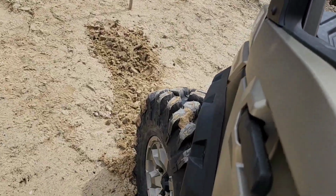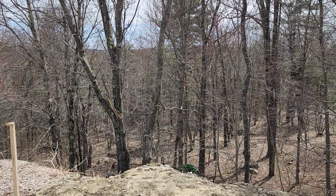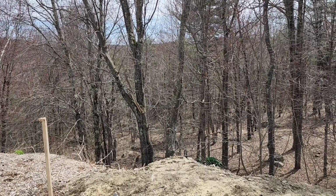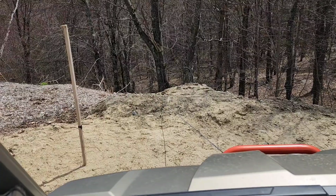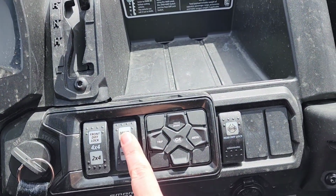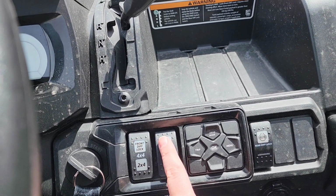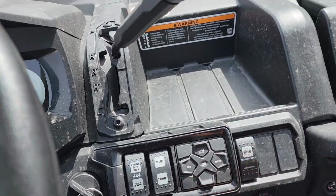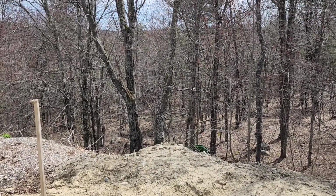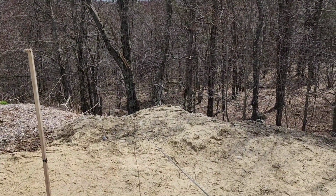I dug in really good. Okay. Where I'm sitting, I can't see a thing. But up here, it looks like you can see some stuff from the camera. So I'm still in the buggy. In order to loosen up the cable, I did have to turn it back on again and loosen that up. I did switch to mud since we're in sandy stuff. It's really wet. I was thinking maybe that would help. And I did do the front diff lock as well. I did not try the rear diff lock, so I'm wondering if I could try that and that would help. But he's resetting, I think, the cables on there. I'm not sure exactly what he's doing down there, but I'm going to stay in here and make sure this buggy doesn't roll down the bank.